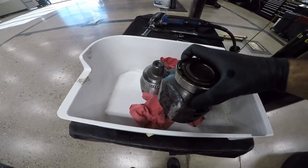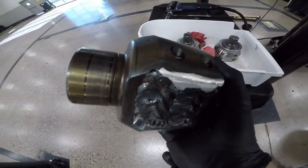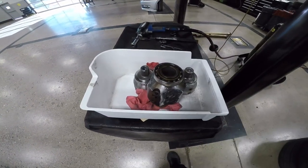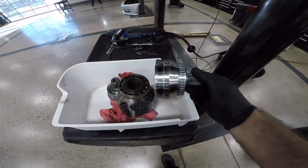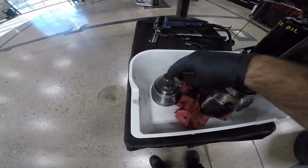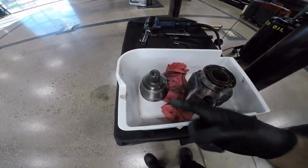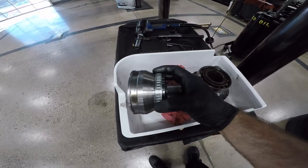This is the welded Torsen differential. All the gear assemblies have been welded together. What this is gonna do is lock up this Torsen all the time, so that's gonna send all the power to the rear wheels. These stub axles are gonna go in place of the front axles just in the hubs, so nothing will be bolted to the front of the transmission. That'll basically take the bearing load, because if you try to run the front wheel bearings without the hubs it'll damage the bearings. We need these plus the wheel speed tone ring for the front speed sensors.